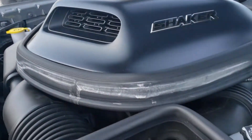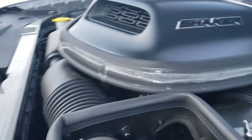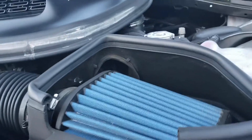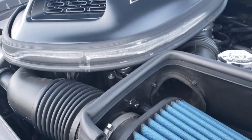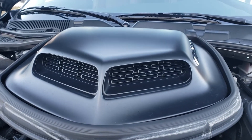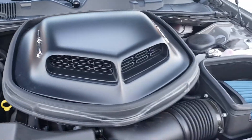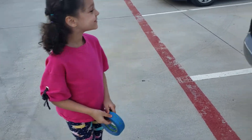What we're going to do as a science experiment is tape this off and drive around to see what we get for intake air temperatures. Because I also have the Hellcat intake tube, I'm going to tape that off too so it's taken out of the equation. This is going to be a couple of parts — drive with it taped up, check temperatures, then remove each piece and check again. My little helper Mia is going to help me tape it up.